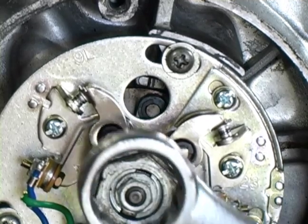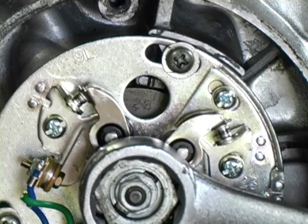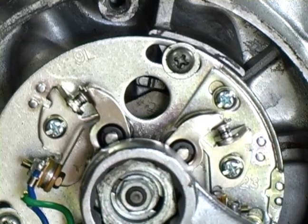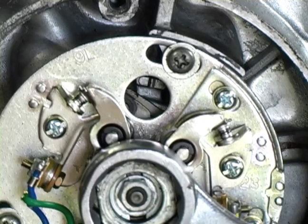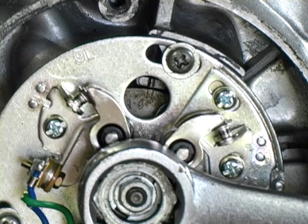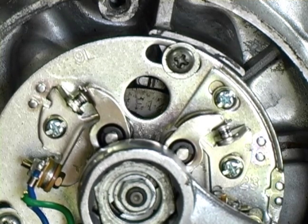So what I'm doing is rotating that advancer again — you can see here's two and three showing up in the little window. I'm looking for one and four. Remember what I said: the marks have an F and a T. F is that firing mark I'm looking for, so now we're coming up close. Those two little spread lines are maximum advance, so when the engine is running and I bring the RPMs up, I should see it with a strobe light come up there. But I'm interested in the F.